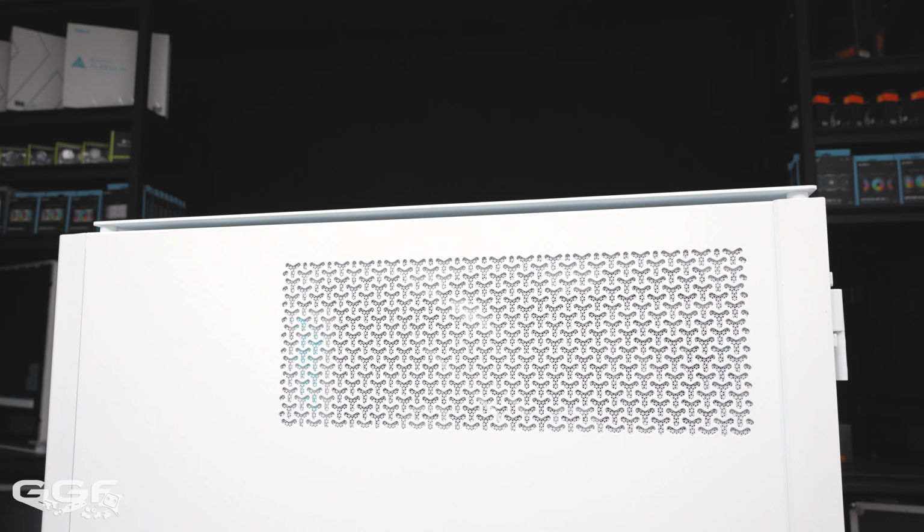I think this is a huge game changer, providing the bandwidth is there, but in saying that, most of the time front panel is used for peripherals, and I'd keep high-speed storage to the rear, because now we've gone from 5 cables for USB and audio down to 1. The only other 2 cables are for front panel power and reset headers, and SATA power for the RGB illumination around these ports. And it doesn't stop there.